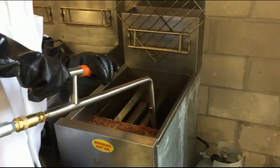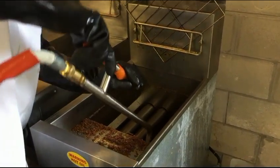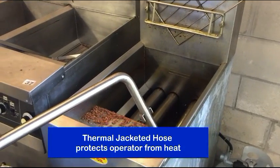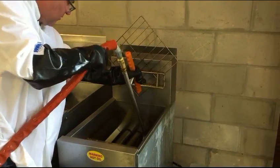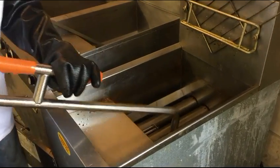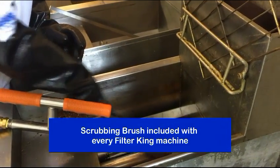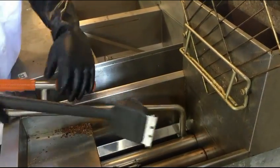We're going to rinse out the fryer — the sides. We have a red thermal jacket on this hose so that it protects you from the heat. As it's doing that, take this scrubber that we send with the fryer and scrub down the elements. If anything sticks, use the back side — flip it over to that side.